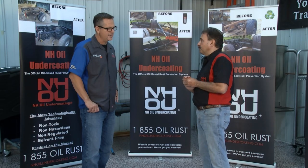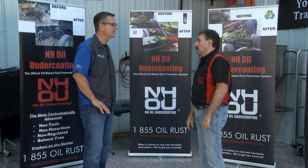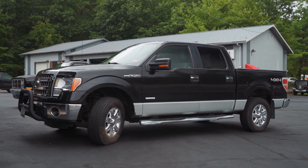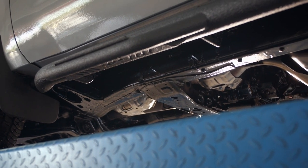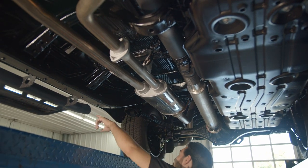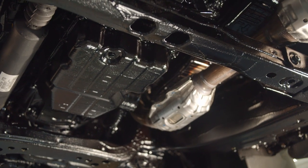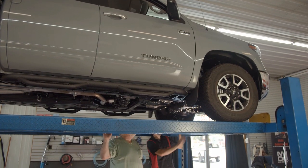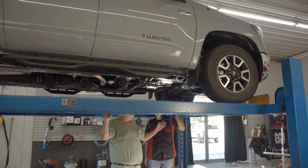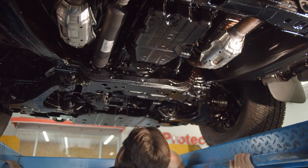Most people will try to mask rust — they'll spray over rust, and it looks nice for a year or two, but eventually that falls off because you trap moisture and oxygen beneath the surface and it continues to grow. For a new truck, we have a wax oil option. The wax is black, sprayed on everything that's exposed for 100% coverage. We use oil inside the body cavities, which is really the critical part. The wax is not a brittle product like the old hard asphalt — it is soft. The key is that you be proactive and come in every two years on the wax so we can watch the vehicle and make sure any breach is addressed before it becomes a big problem. So it's really a maintenance program.